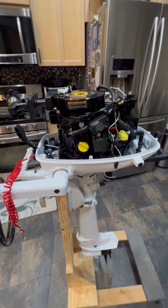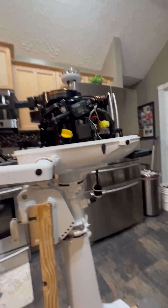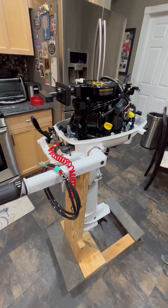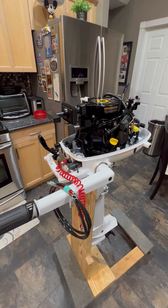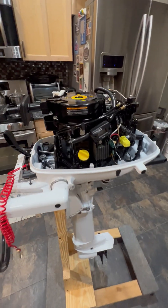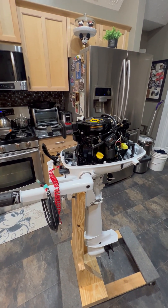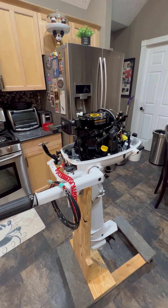She was test run when I picked her up. A lot of people were concerned about vibration — perhaps the single cylinder would vibrate really bad. I'm currently running a two-cylinder eight-horse Honda, a very old motor I got for free when I bought my sailboat — all it needed was carburetor repair. She's been a good motor, very smooth, starts first pull every time. But the motor had been used predominantly in salt water and apparently not flushed well, and it actually popped a hole in the water jacket right near the cylinder heads and started leaking under the cowling. So I figured it's time for a new motor. I like the fact that this will charge the batteries when I'm running — I've got solar panels on the boat, but sometimes you need to top them off, and this should work great.